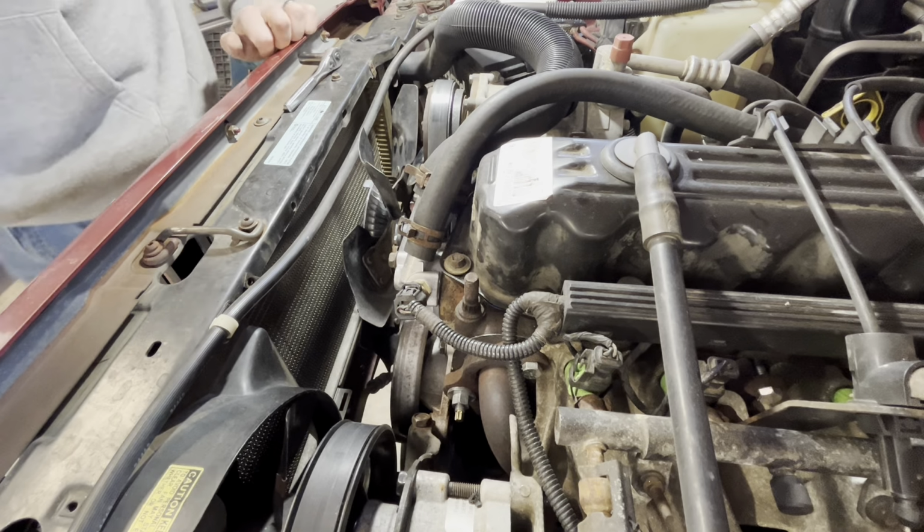A lot of times these will click or make some kind of click noise. I'm going to go get some little needle nose pliers. So anyway, on the blower motor issue, everything was fine. I actually ended up taking the whole dash out to try to diagnose that. It took forever. And then I was bench testing it, and that's when I figured out the wiring was backwards. So somebody's definitely been working on this in the past and had connectors apart.